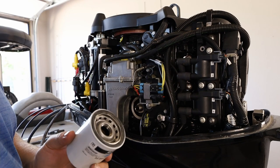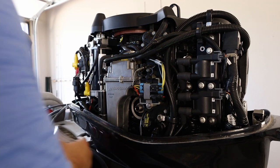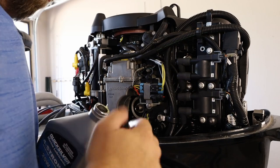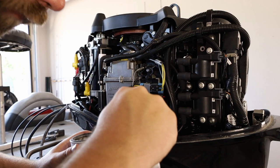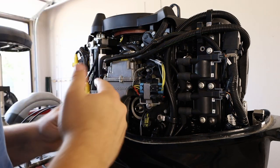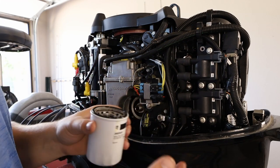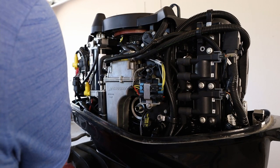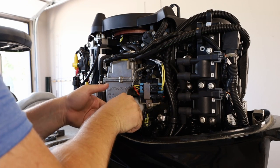An important part of reinstalling your oil filter is making sure you lubricate the seal. Some people use their old oil — I like to crack open a new bottle and lube it up that way. Just coat it on there — a little coat, nothing serious — but you want to make sure the seal is lubricated so it doesn't get bunched up when you tighten it down. Go ahead and start the tightening process.